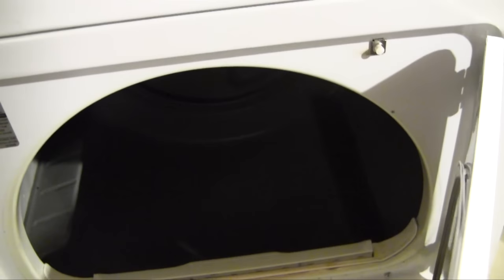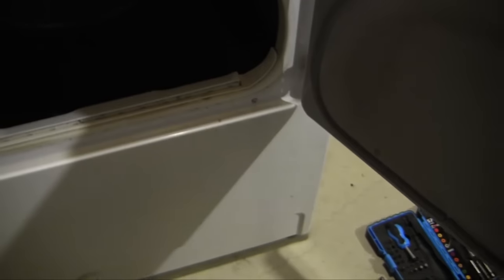It's too bad — I see a lot of these dryers get thrown away for such a simple thing. So if your dryer quits drying and everything seems to be working but it makes a really bad racket when it shuts down or starts up, more than likely it's that squirrel cage. It's an easy fix — 33 bucks. Thanks for watching.